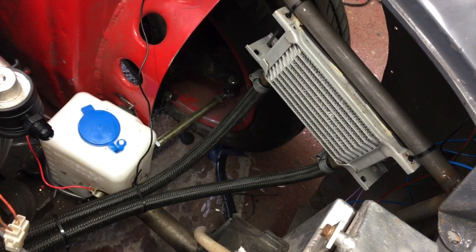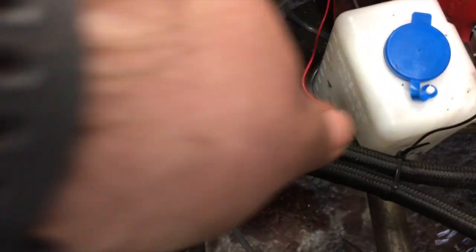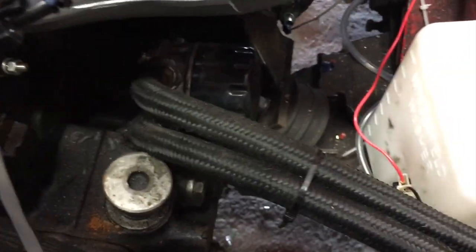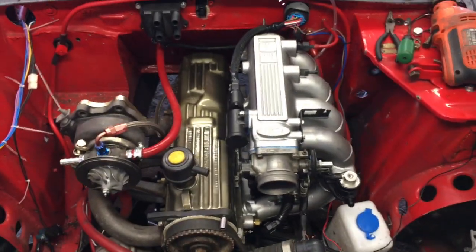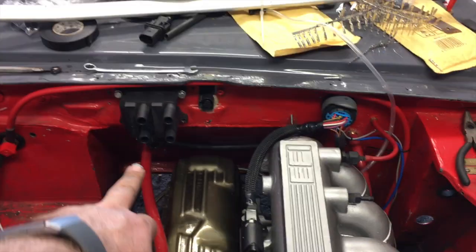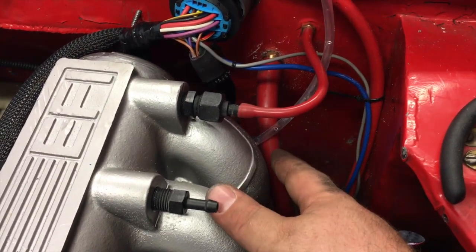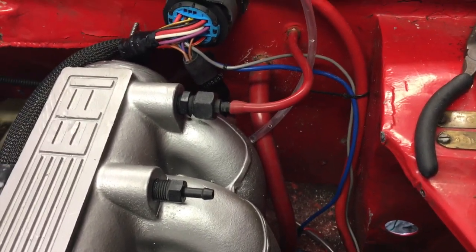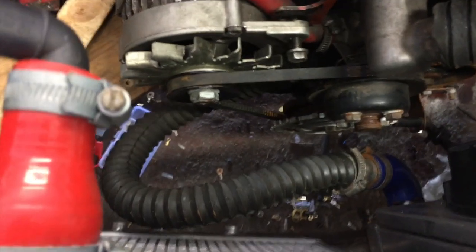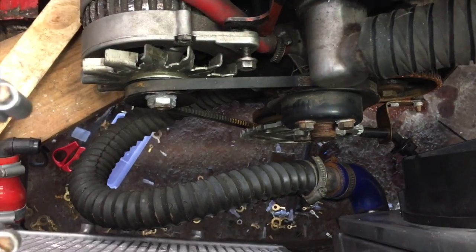So I focused on a little bit of plumbing. We've got the coolant and oil lines plumbed in — the oil cooler is on the front tubular frame, with oil lines going down to the sandwich plate. I've also got some pretty subtle coolant lines: the turbo coolant line goes down to a bulkhead connector on the other side of the firewall. There's also a coolant line coming out of the intake manifold into a bulkhead connector, and a little MAP line to a bulkhead connector as well. And the last bit in the engine bay — got the main bottom rad hose connected up. It still needs a jubilee clip on it, but it's just to make sure it all fits.